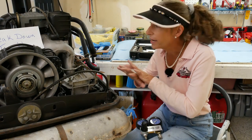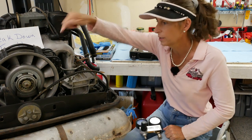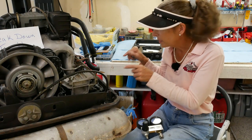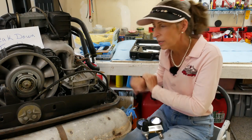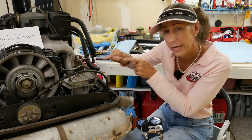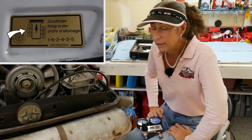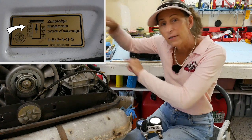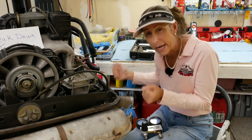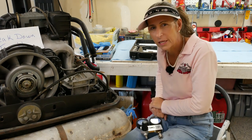I know this should be done when the engine is warm, but we have it out of the car, and it's difficult to get to these cylinders when the engine's actually in the car. Our first step is to pull each spark plug, then rotate the engine and get cylinder number one to top dead center, and go around the firing order. It's kind of nutty — it fires in diagonals across the engine — but with all the spark plugs out it's easier to turn the engine over and move from one cylinder to the other.